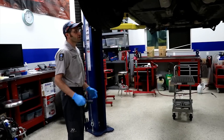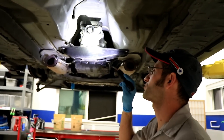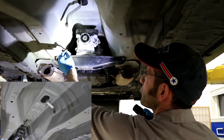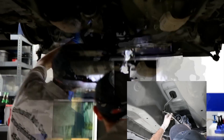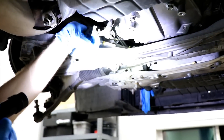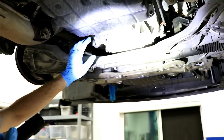As far as taking the powertrain out, there are a couple of things you've got to do. Remove the driveshaft right here — that's going to cause you to also remove the exhaust. We're going to unhook the rod for the transmission from this lever assembly. The catalytic converter support got removed as well to make room.